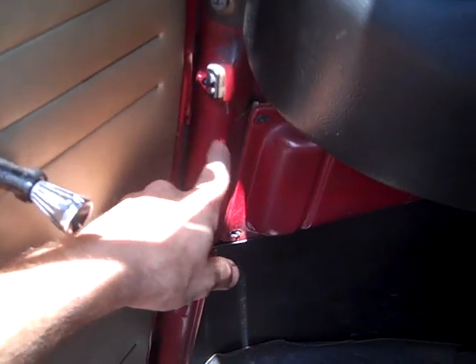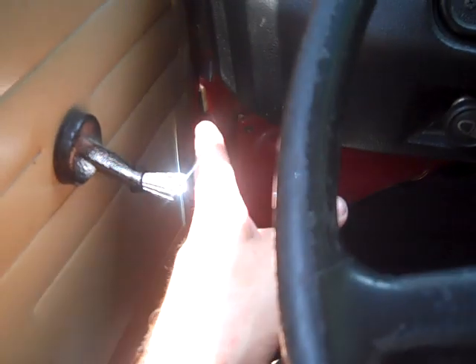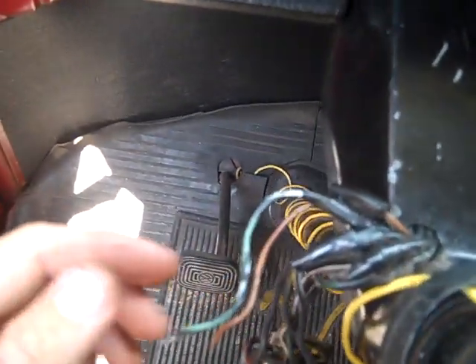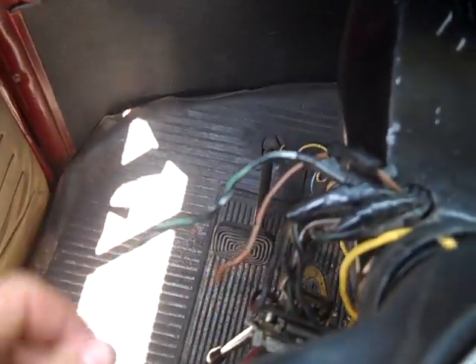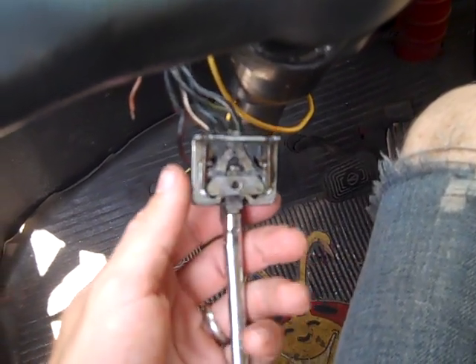The other problem was my interior light up here didn't work. Me and my brother ran through the wiring guide and figured out that a little buzzer has a ground in it, and if that ground is connected and missed somewhere else it just won't work. So we just unplugged it — I think it's the buzzer ground. When the key is on, you get your buzzer; we just unplugged that and never had any problem. But a lot of your stuff actually goes through that — grounding is seriously serious in the bus.